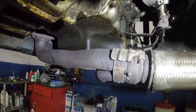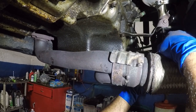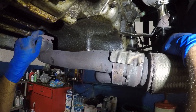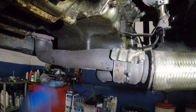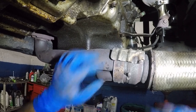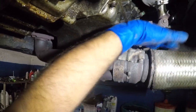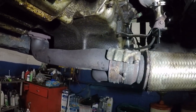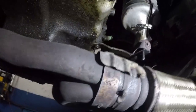All right, next. Just make sure you check to see if you have your O-rings together, which is good. All right, I'm really not feeling much there. Yeah, it's there. All right, so what I'm gonna do is, I do have a sealer that goes here, all right? Sealer onto this little guy. So I'm gonna go get that, and I'm gonna put a little bit of that onto that, all right? Okay, never mind. We're gonna do that later, all right? Because we need to put in our intermediate shaft. That was the next step, all right?